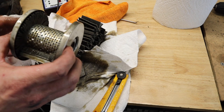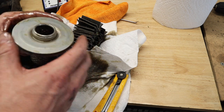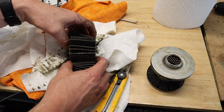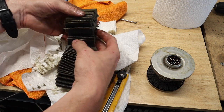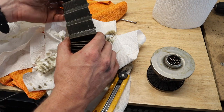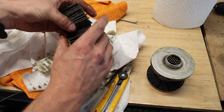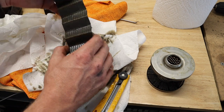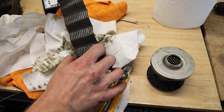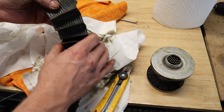You can see what that looks like — the oil is going to flow in here, go through your filter, and then pass back out. All you're going to do is unwind this, start at the end, and go through it checking for any kind of metal flakes. Now if your engine's making metal, you're going to know it.